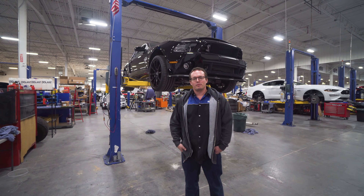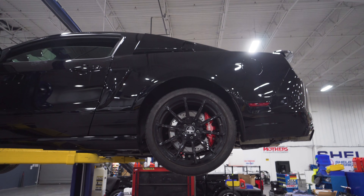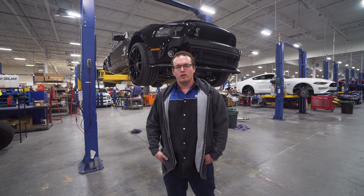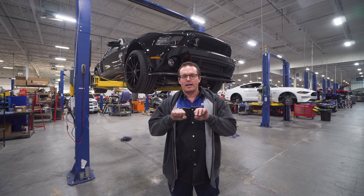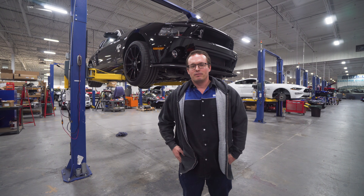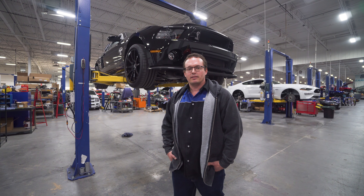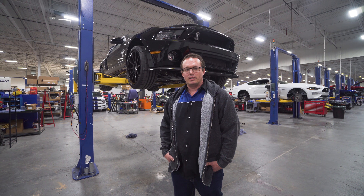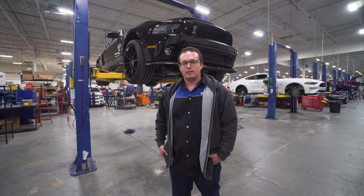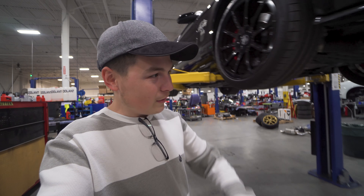I'm Chris Ruby with Shelby American. We're looking at Austin's car here — technicians figured it out pretty quick. The culprit was the upper control arm; it's an adjustable upper control arm and it had backed out to the point where it started to extend, and now we have clearance issues. We're going to take it apart, get the cover replaced, repair or replace the lines as needed, make sure everything's still good on the inside even though we lost some fluid, and then get him back on the road.